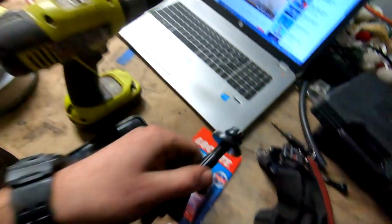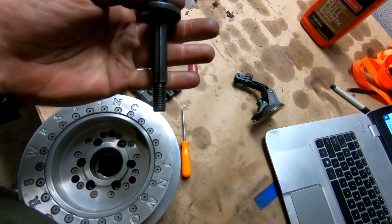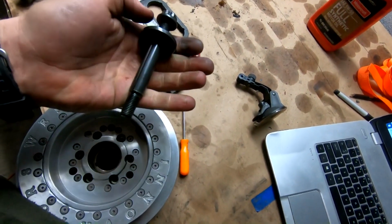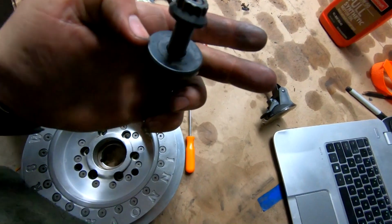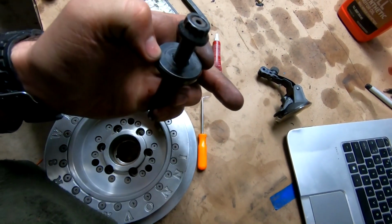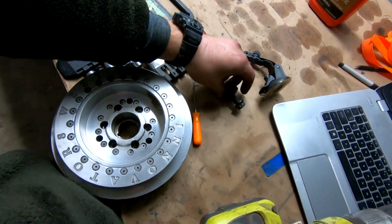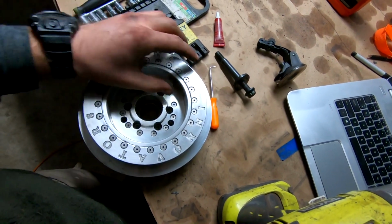So we're gonna wind up using the crank saver stud. At least this way we'll be able to thread it in, you want at least 5 threads in according to Modular Head Shop. And we'll put our ARP lube around the base of the washer and the nut, and pretty much crank it on that way. So this is gonna get eventually torqued down to 130 foot-pounds. So that's basically what I'm gonna go ahead and do. Let's start the process.